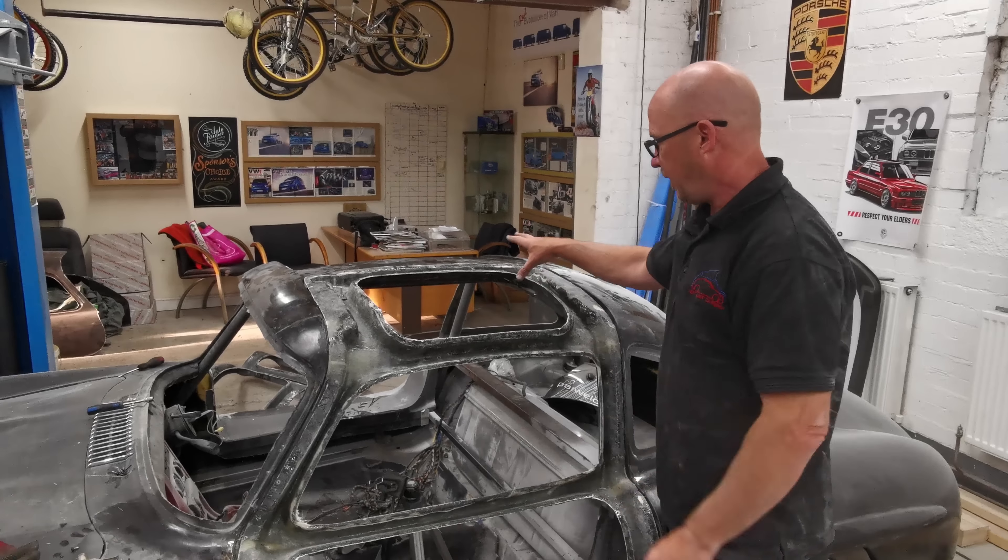If I press that — press it twice — you can hear the compressors kicking in, putting more air in. Right up at the very top, that is how much pressure is in the bag — in the tank. So if I give this to Alex, point at the back bag, I'll just start the engine. So I've got plenty of pressure — you can hear the compressors. At the moment it's on 144 psi, so when it gets to 149 psi it'll stop. I can drop it down by pressing the preset button. On the rear it's now at 30–35 psi — that's what I usually like, running low. That's how I run it.